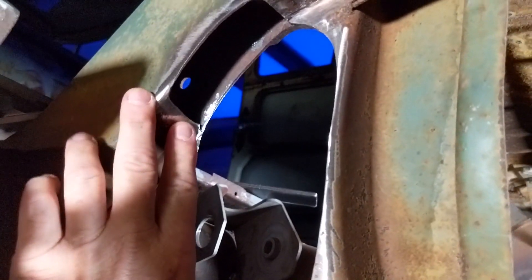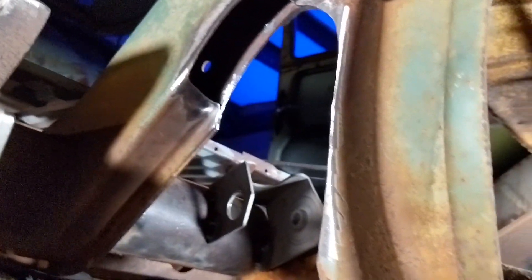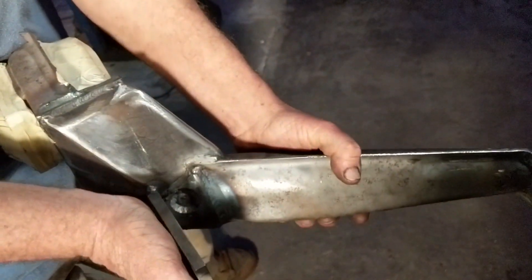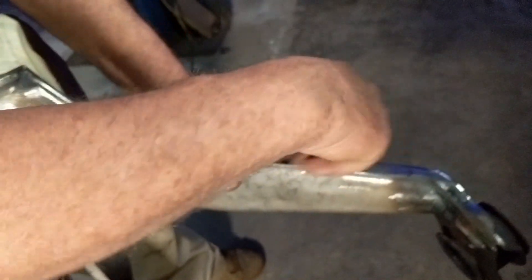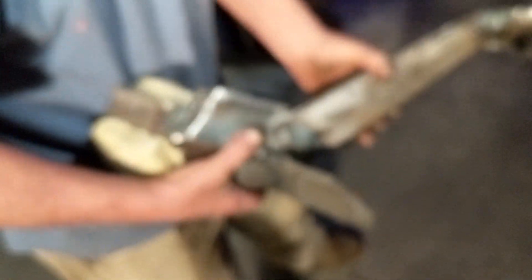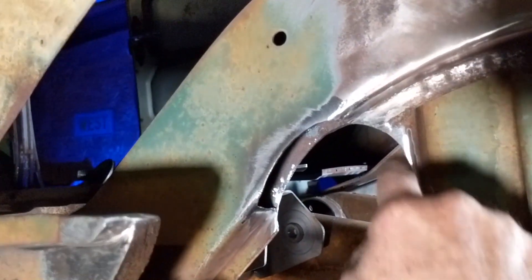It's way cheaper than brackets. Not all of these have to have this notch — this is like the blue bus that has 17-inch wheels with a big offset, so the control arms are narrow. We raised them two and three-quarters inches and moved where the spring plates sit, cutting the end off and moving it over. Every single end of this is customized to fit. Being narrow changes the angle, so as it goes up you can see the clearance issue — if it stuck out further your clearance would be out here and you wouldn't have that problem.